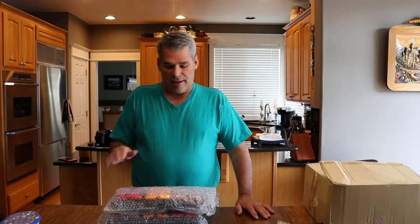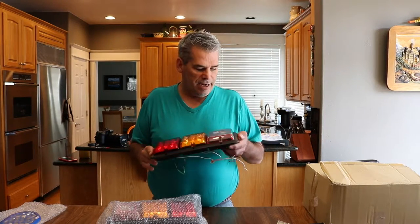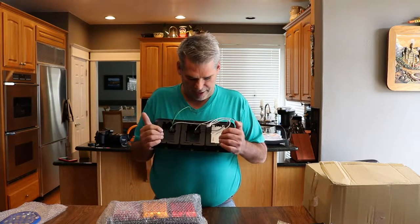The RV doesn't have a back cap — it's like a class C, comes around in one piece and down to the bottom of the RV, and the manufacturer put some pretty cheap tail lights on it. I've noticed some of the screws are actually starting to rust — I pulled one out and it's got a little bit of rust all the way through, so some water is getting through into the wood and behind the fiberglass. Not enough to see any delamination, but I need to replace those lights with something better and seal it better.